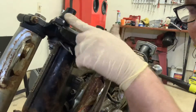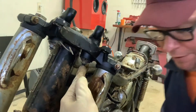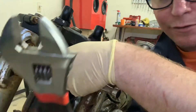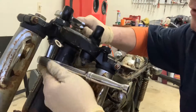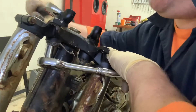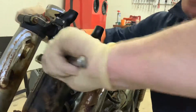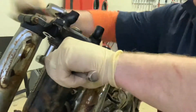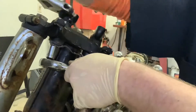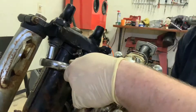Next step: we've got to get the other side of the collars off. We've got two bolts here — again, they're 12 millimeters, so all you're going to need is a 12-millimeter on this one. I've already noticed this thing is spinning, so what I like to do is just grab a crescent wrench, fit that along the top edge here, just so you've got something to pry against. Then we're going to try to break these things free. I'm probably going to use the frame here — there we go, got that to come free. This bike is extremely crusty, so I don't want to work this aluminum too much. I'm just going to spin this around and strip all this stuff apart in the sandblaster, so I'm not too worried about it.